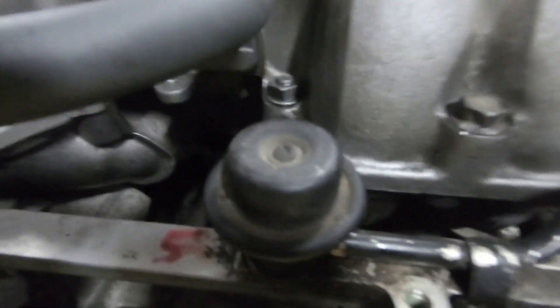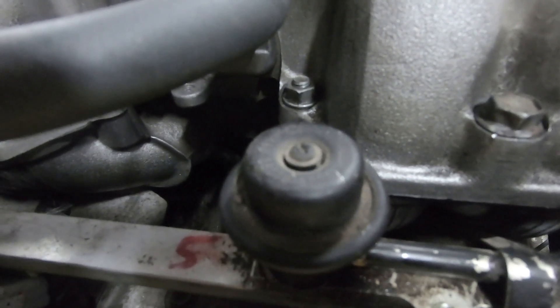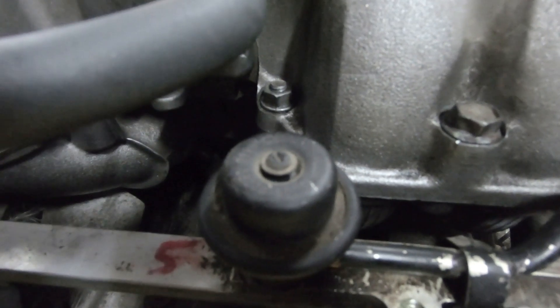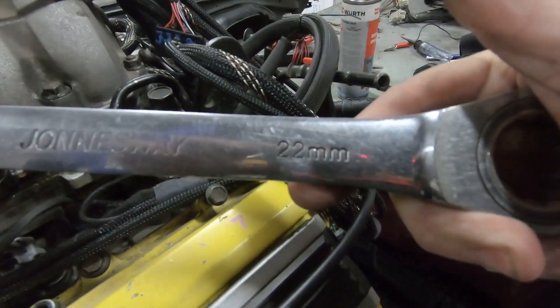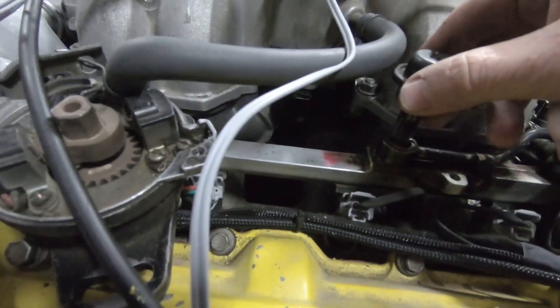So what is it? It's this little unit here and it's on the inlet - not to be confused with the fuel pressure regulator, which has got the vacuum hose on it. This one has a screw and you shouldn't go fiddling with the screw. You can tell when the engine has fuel pressure because that screw will pop up. This has got a couple of washers that are very important to put in the right place, and it has a 22 millimeter nut on it.